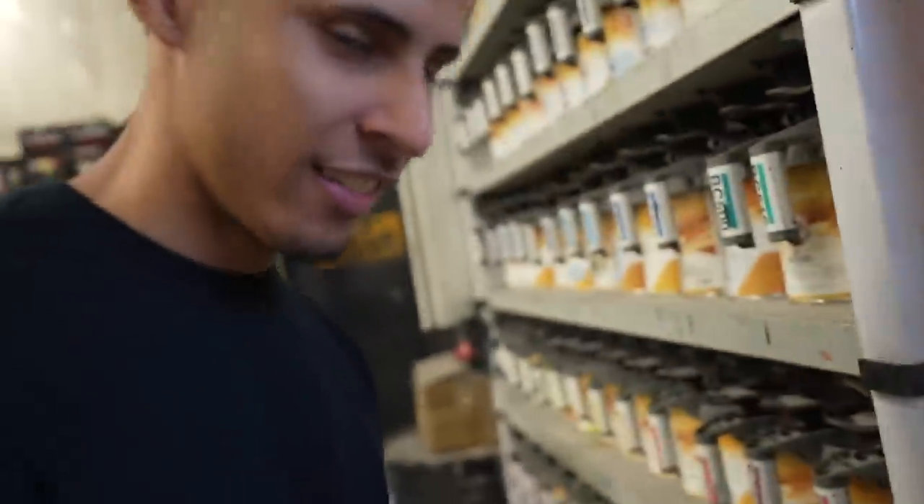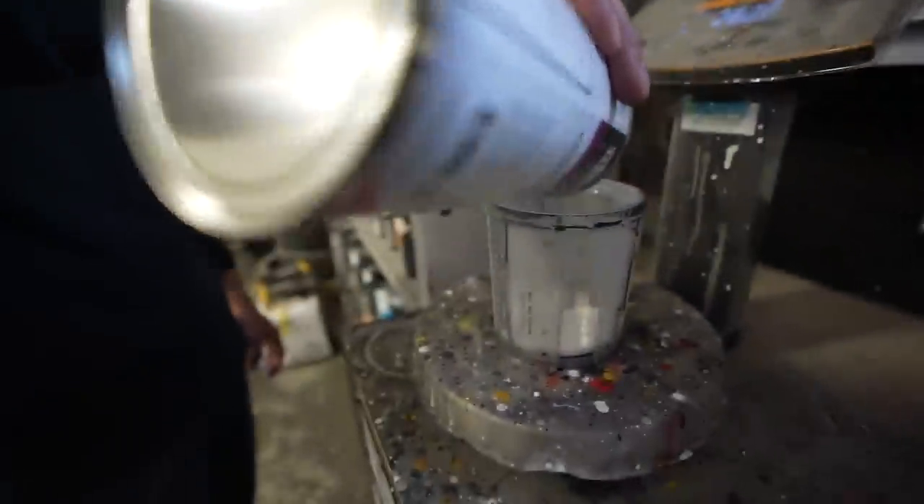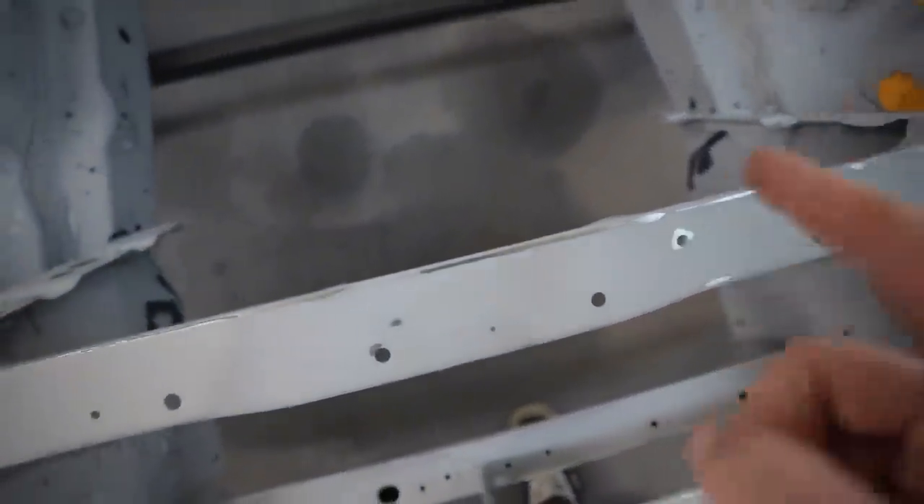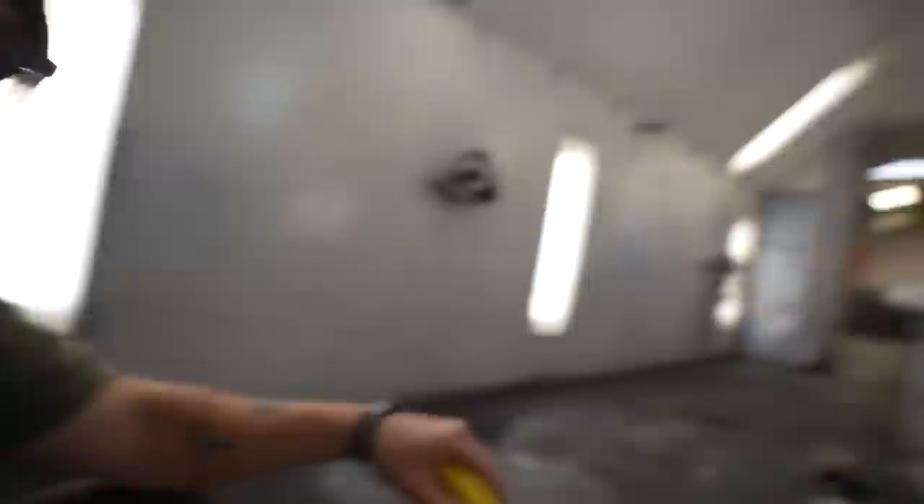What are you mixing up right now? Sealer. So if you guys don't know what sealer is — look at the end result, right? There's a bunch of different colors in here: shiny bare metal, the primer, the bondo. When you lay paint over it, the paint will have different shades of color. What the sealer does is it's basically a thin coat that levels out all the color, so when you spray the actual color it all matches. If you spray without sealer, especially a color like red, you'll just see bright and dark spots everywhere.